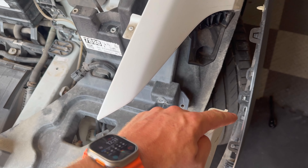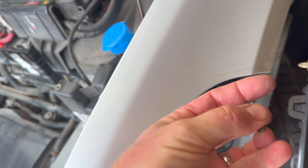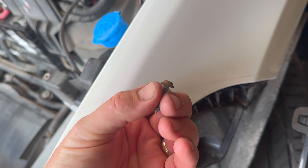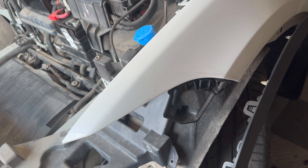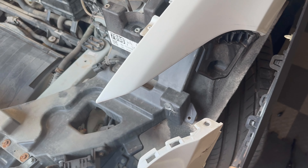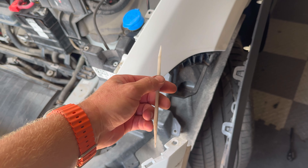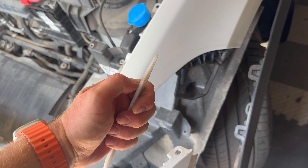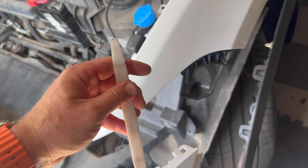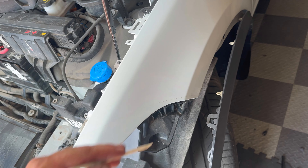Plug them in and see if they work. Here is where that torque screw goes through and it hooks into the bottom of this plastic bracket right here. You can see it goes into this grommet up and behind here — and here's the screw itself. I'll put the torque number down in the description. It's just a flat machine screw of some sort, and that's actually the trickiest part. Everything else is pretty good. I do recommend getting a trim tool — this is available at pretty much any auto parts place. It's a heavy duty nylon plastic tool, kind of like a big popsicle stick, tapered on each end with slightly different thicknesses and widths. That allows you to go in and press these little clips down without damaging the metal and paint.